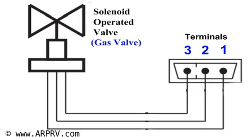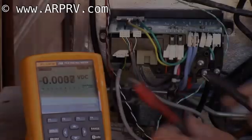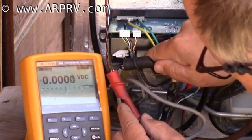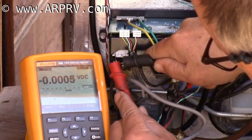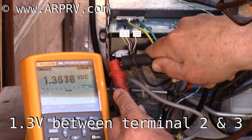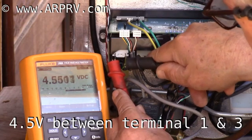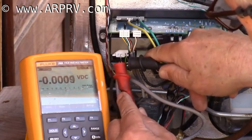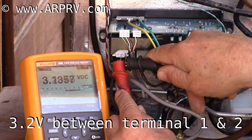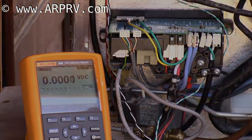On the left of the drawing is the gas valve representation. On the Norcold, when you turn on the gas on this particular refrigerator, it has low voltage to the gas valve. The gas valve only measures 1.3 volts across the inductor. But if you go over to your ground, you're going to see that you've got 4.5 volts at one of the inductor leads with respect to ground, and 3 volts at the other inductor lead. Most gas valves will run off of 12 volts, so you'll measure 12 volts across the two leads.